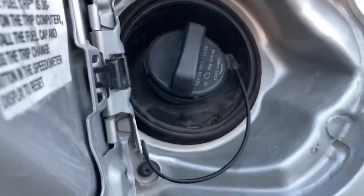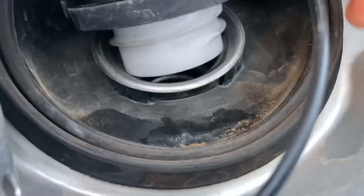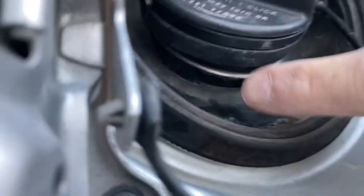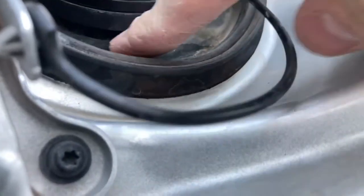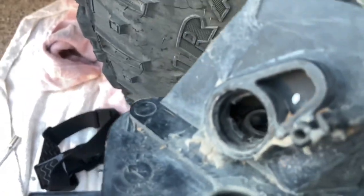Alright, so it looks like we're back in business. Underneath the gas cap nozzle here, there are these little plastic vents along the underside. Those are little vents that let dust go right in — the dust goes down this hose and into the top of the solenoid, which goes into here and clogs up this whole box, completely gets it full of dust.